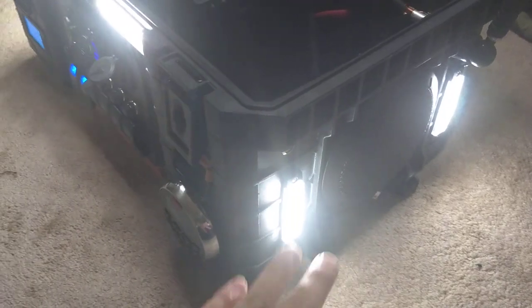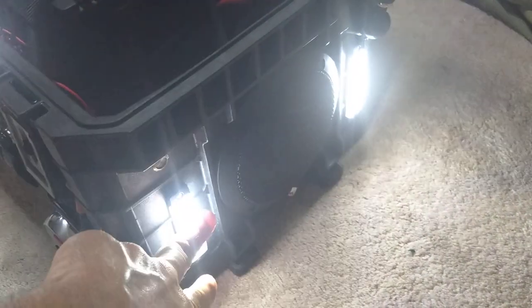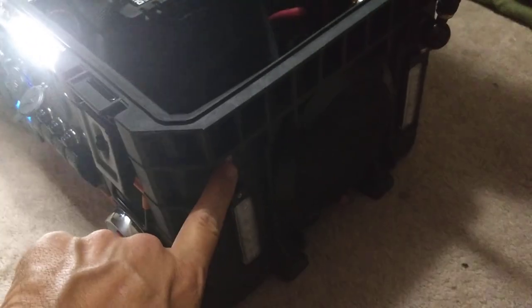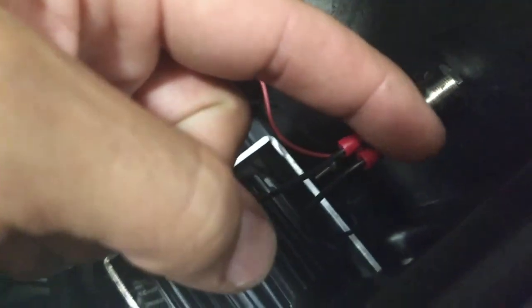For the lights, I wanted to be able to turn them on and off at various spots on the toolbox. Power comes from the switch plate to the lights — split across both lights. The negative side of each light comes back together into a splice to one side of the push button. This is an on-off button, not a momentary contact — it clicks on and off. When I click it off, I disrupt the ground. In the on position, the ground wire from the lights goes up to the switch and then to the bus bar, so I'm switching the ground side, which allows me to individually control all the lights.